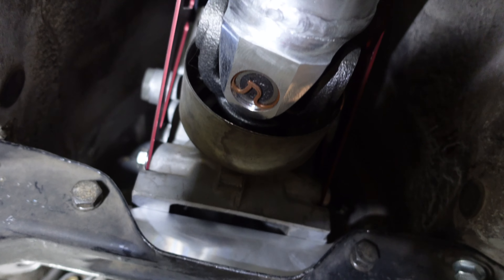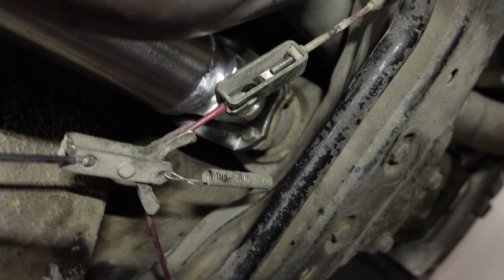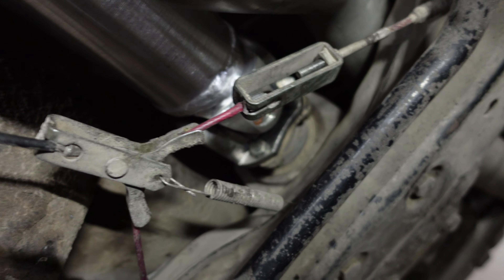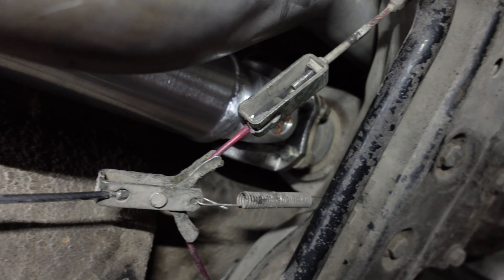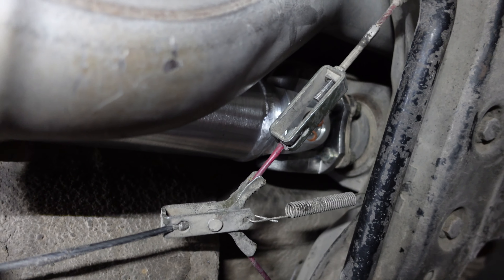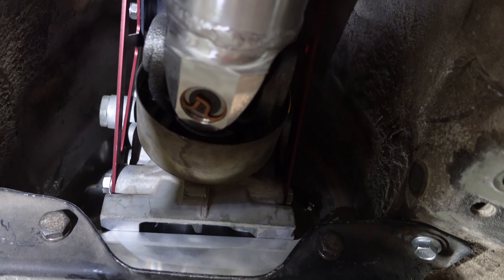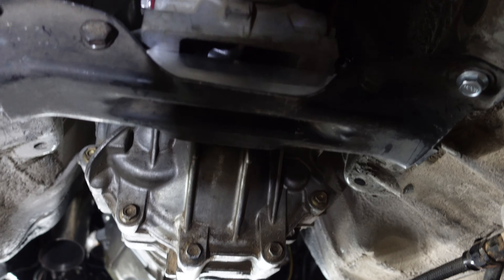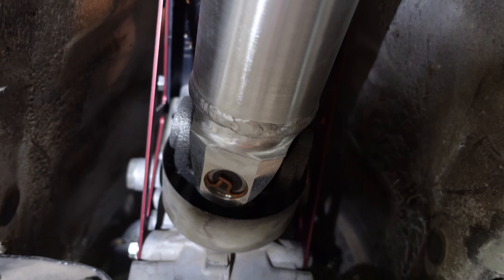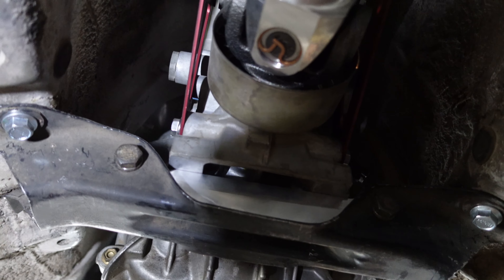It has been a few weeks and we have the rear drive shaft in. Everything is looking really good and everything bolted up just fine. This is a Shaft Masters aluminum 3 inch aluminum drive shaft. They have the rear differential flange and the front yoke for pretty much anything that you need. This isn't sponsored — it's the second one I've got from them and it's always perfect, so I really appreciate that. I think this is going to be it for the CD09 swap videos. I will make a first drive video when we get this going. If you have any questions or comments about this swap, definitely drop them down below — I'm pioneering this so it's not like I have all the answers, but it's looking really really good. Thanks for watching and I'll see you guys next time.